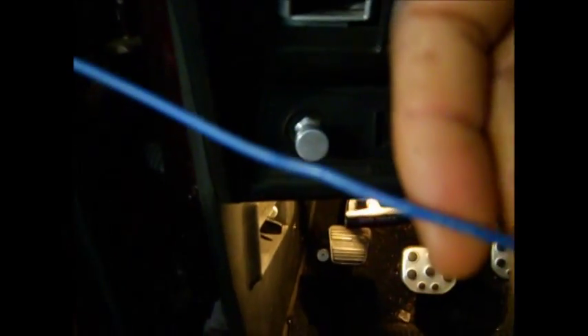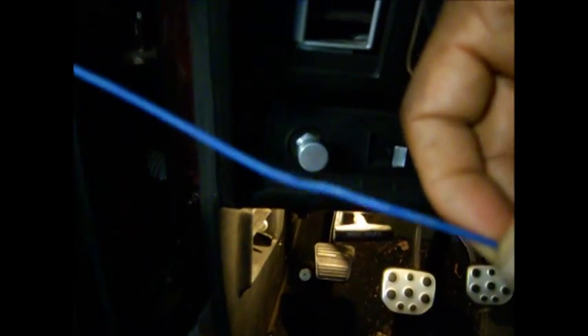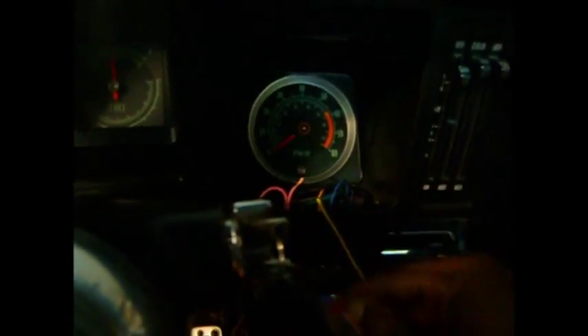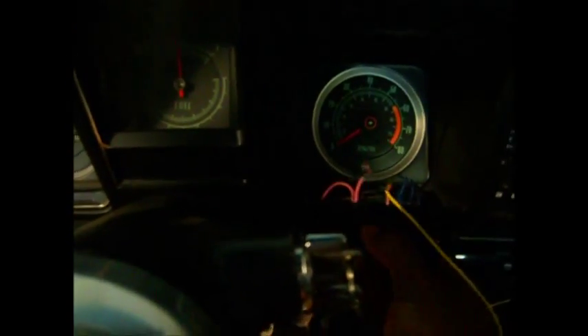I finished hooking this up. This wire is coming all the way from the engine compartment — this is the oil pressure sending unit wire. This is great because it's labeled. Now this wire you hook up to the brown wire coming off your computer — the MIL wire, the malfunctioning indicator light wire — and you just tie this in. Now with this harness, remember this type of dashboard doesn't have a circuit board in the back that brings power, so you're going to have to actually bring power to it if you don't have power going to it already.